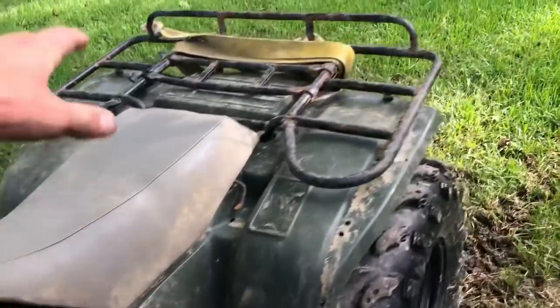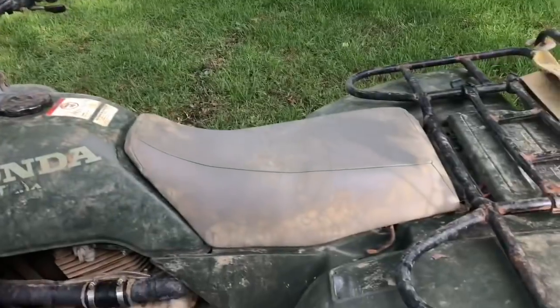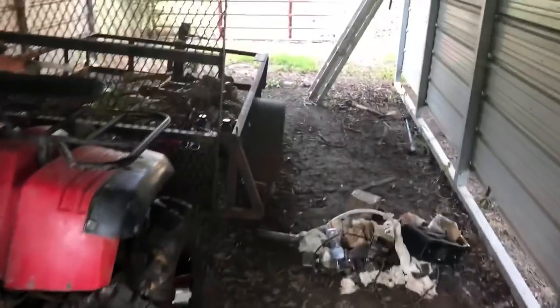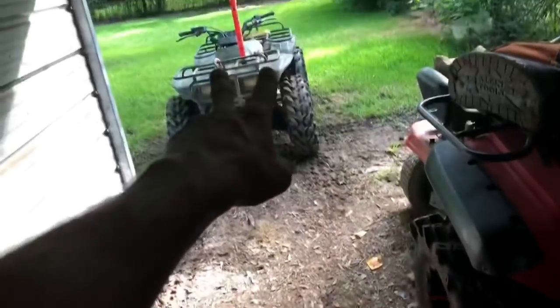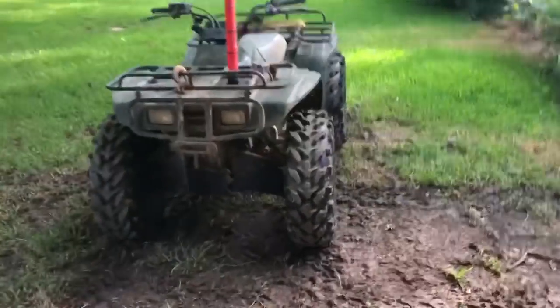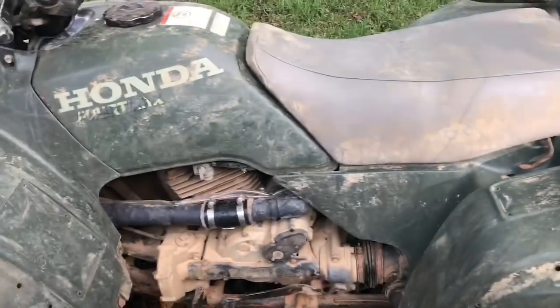But yeah, the snorkel did great. So that was good. I had the airbox underwater a couple times. Nothing went wrong. Airbox was bone dry every single time it went underwater, and every single time it died underwater, by the way. So that was good. Oh, and by the way, the second time it died underwater, it wasn't completely underwater. This part of the snorkel was barely underwater. It just cut out on me for some reason. The airbox wasn't even close to being under. So there's a problem with that.